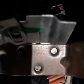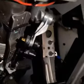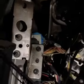It's 2 Phillips bolts that you take off, and then it's a 10mm bolt that holds this one right there. You take that 10mm bolt off as well, and then it drops right down, sits right there in front of you. You don't need to take it out of the car, because the emergency brake cable is still hooked over to it. All right, you got a bracket. This bracket right here is 4 10mm bolts, 2 on each side. You go ahead and zip that out. I have already taken the liberty of doing so. Boom, boom, boom, boom. Then you go up underneath here, and this is the tricky part.